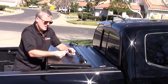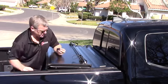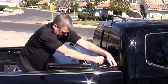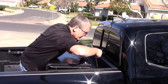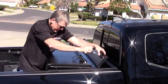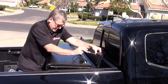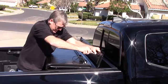You take the small Phillips screw and drop it into the hole on the top — there are two. With the opening for the buckle facing rearward towards the tailgate, put it into position. Then there's a stem screw that goes in from the opposite direction, and you should be able to easily get the thread started. Use caution to make sure it's tight but not overly tight. The stem screw goes in from the underneath side and catches the screw easily — snug but not over-tight.